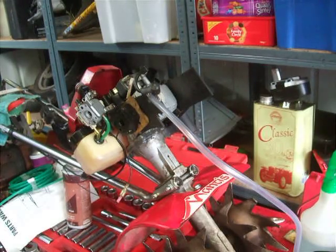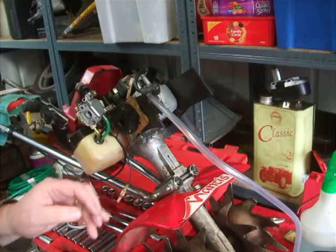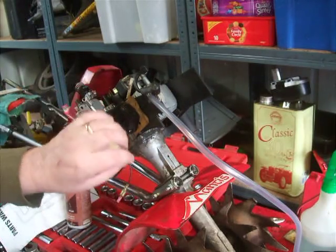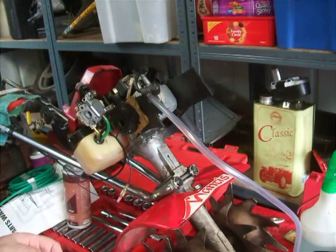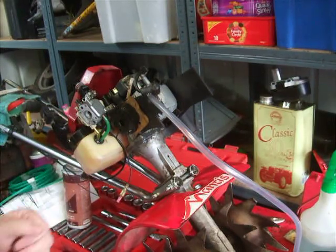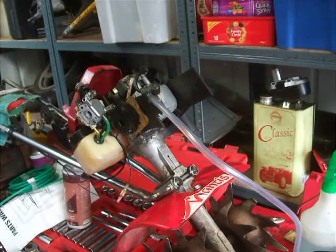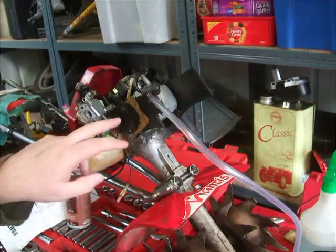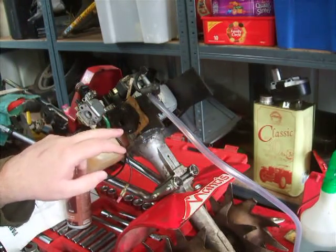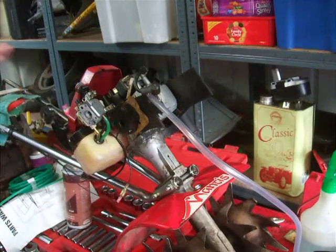I had a real problem this morning trying to get it to seal on the carb. Normally you can just cut off some rubber and slide it in and it'll be fine, but it wasn't this time — it leaked. I slid the rubber up behind the inlet manifold, and it still leaked. So in the end I took it off and put two screw holes in the rubber and put it in that way.